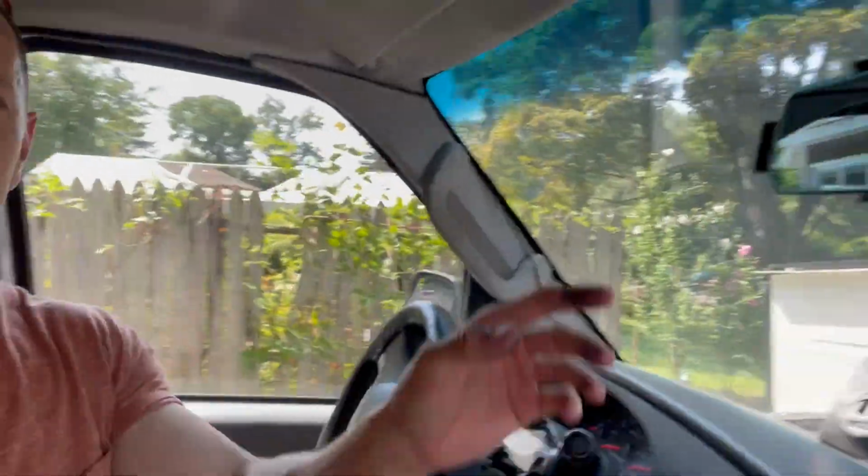In any case, the LED light on this turns on, but the camera does not, and I discovered that this particular 12 volt plug-in had basically a voltage regulator, so the camera only is willing to receive 5 volts, whereas of course the rest of the vehicle is 12 volts. So I've got a little voltage reducer that I'll show you guys here in a minute that I'm going to then wire in, and fingers crossed, if that's all I need, then I'll have a functioning working backup camera that I don't have to fiddle with something falling apart every time.